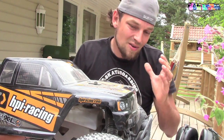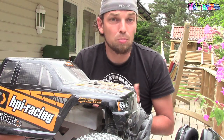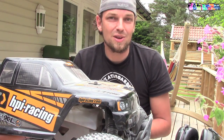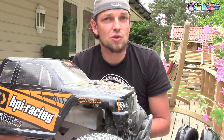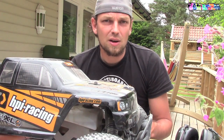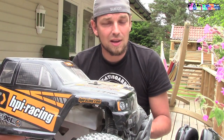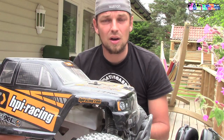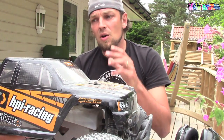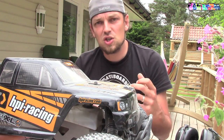So far, the first 2 running videos were not that spectacular. I wasn't that pleased. And right now I'm really getting to the point where I'm starting to get a huge kick out of this car, and I can't wait to do some actual monster trucking with it. We're going to set up a tiny monster jam over here in the garden. Hopefully get a few more guys out with their Octanes. They're all properly broken in right now, so forget what I said about it being the ignition box. Could be that yours does have a defective ignition box, but just stock up on spark plugs, a whole lot of them, and even if they do look good, just switch them out.